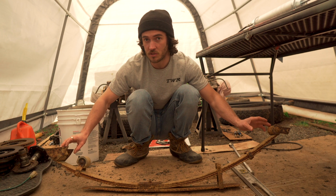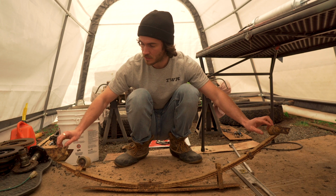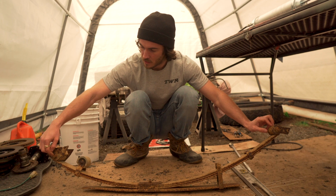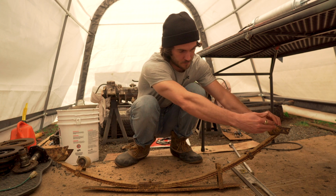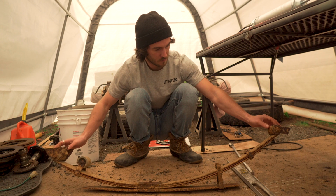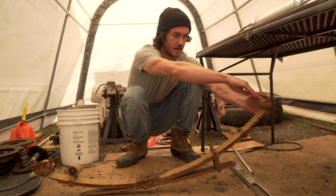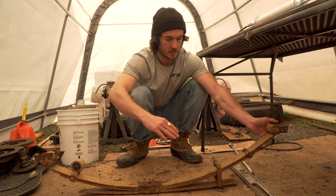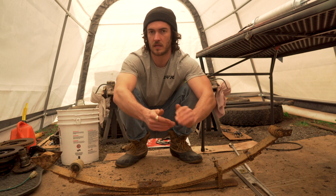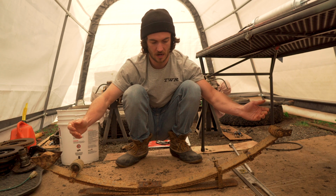There's a couple ways to do that. One of the easiest ways is you take the datum line. The datum line is a straight line drawn from eye to eye of the leaf springs, and you go 90 degrees from that. So you draw a straight line here, and then you go 90 degrees from that line. That's going to theoretically give you the most optimal use of your leaf springs for up and down travel.